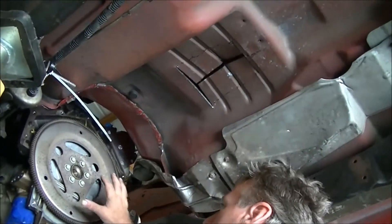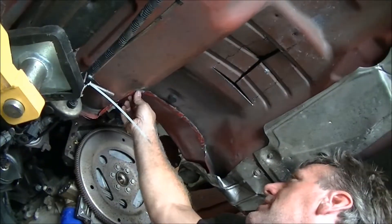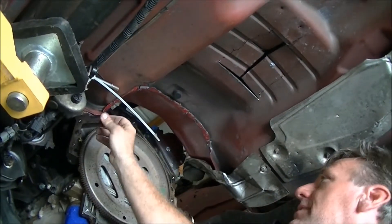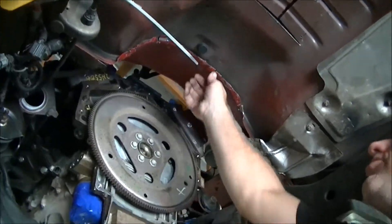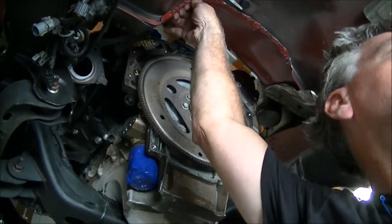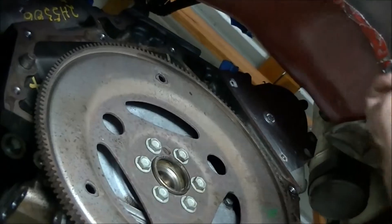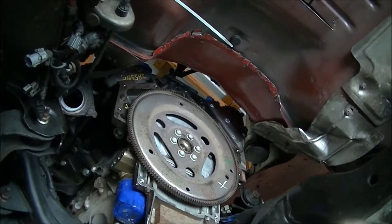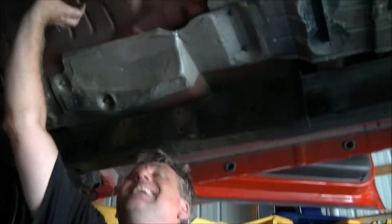So that's what we've come up with. The only thing I've had to do to this truck to get this big transmission to clear is I've actually had to make some small cuts and hammer back the pinch welds. If I were looking for a show quality vehicle where you put mirrors underneath and everybody's looking at it, I might clean that up and lay a piece of steel across that and weld it in. But in this truck I'm not all that worried about it, so I just pushed it out of my way to get to the bolt holes. That's the work we've done underneath the tunnel to make it clear — that's as simple as it gets. This is Scott from lsstack.com. Thanks.